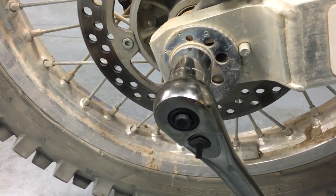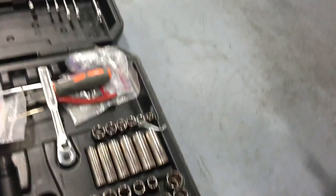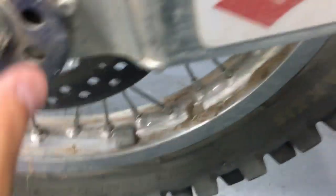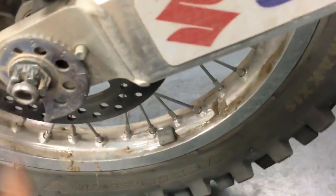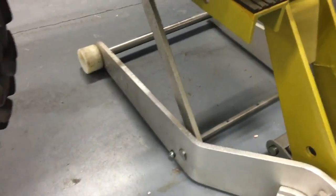So what you do is there's a 24mm socket and there's a cotter pin right through here. You take that and undo it. First of all, undo this stuff while the bike is still on the ground — I learned that the hard way more than once. Then you jack it up. These are pretty cheap jacks at Harbor Freight, and you just kind of tighten it or loosen it accordingly.